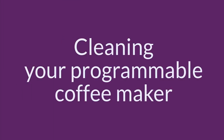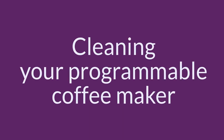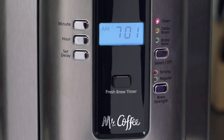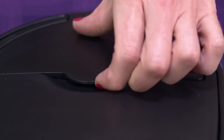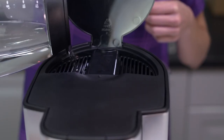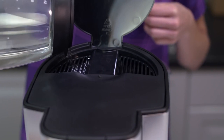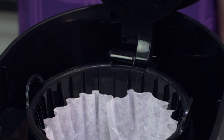If you have a programmable coffee maker with a special cleaning cycle, you can easily maintain and clean mineral deposits from your coffee maker. The red clean light will turn on and flash to let you know that your coffee maker needs to be cleaned, and the light will turn off after the clean cycle has been completed. Here is the procedure to use the cleaning cycle. Pour four cups of undiluted white household vinegar into the water reservoir. Before cleaning, make sure that the water filtration disc is removed from the machine.